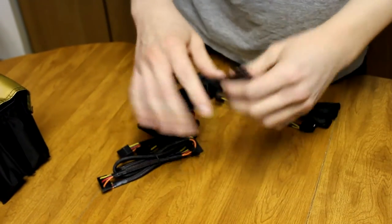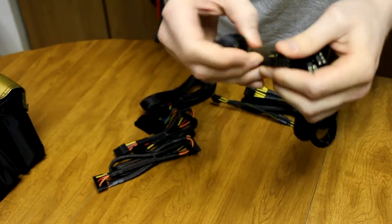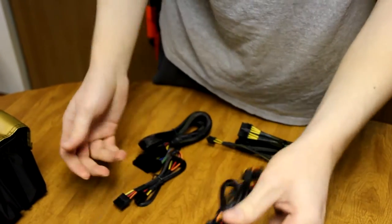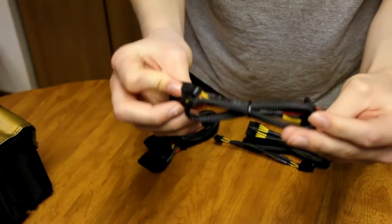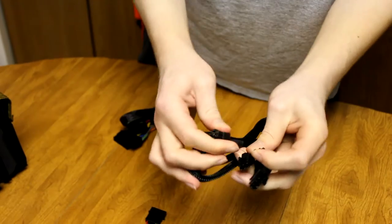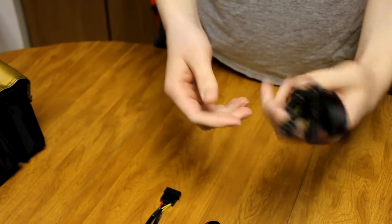We have a CPU cable here. This one's got a CPU with two four-pin connectors, and this one looks like a single solid eight-pin. More power cables here, but this one's a smaller one, maybe for two drives. Floppy drive connector too — I don't know who uses that anymore. Here's a PCI-E that still breaks off, same as the others, so you have three of those, which is really nice. And here's your big 24-pin motherboard connector.